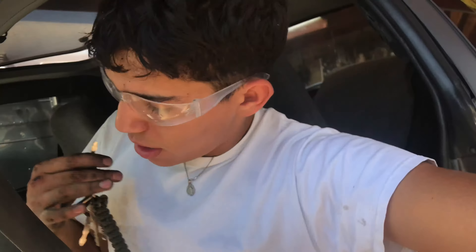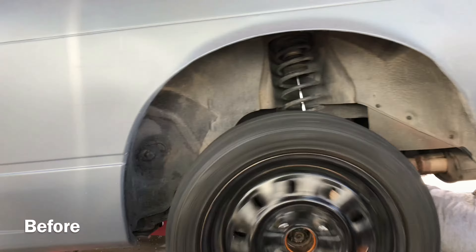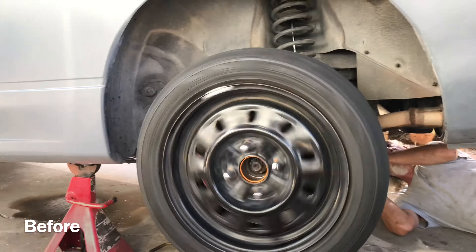I'm gonna get this thing cleaned up, put some new oil in it, and send it in the car. Now we got this diff ready to go back in the car. I put the diff fluid in it outside the car because look where this fill hole is right here - and if you guys are familiar with 240s, that goes right into the axle. It's a stupid design, so I did it outside the car to make it a lot easier.